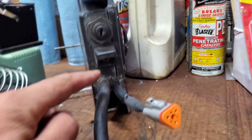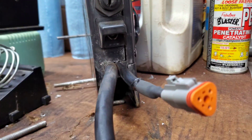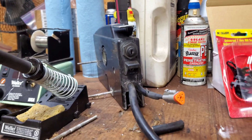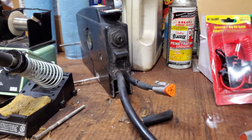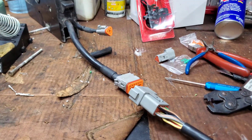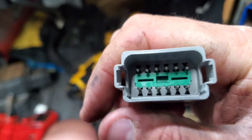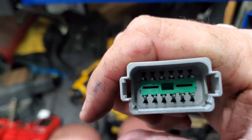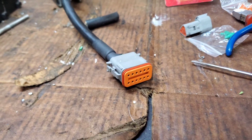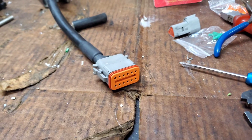The kill switch has a little switch right there — you pull it down to keep people from being able to start the boat. A lot of these keys are universal, so it's a good security measure. You can see it's more than a one-handed operation to push these two connectors together. One thing I didn't mention — see how it's got a relief on that corner? It's like an indexing relief so you know which way it goes in. When you push it together that seal is so tight it's very hard to push all the way in, but once you do you never have to worry about anything getting in there.